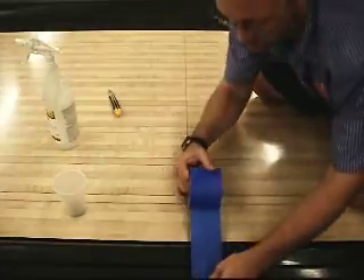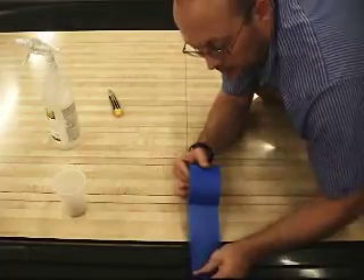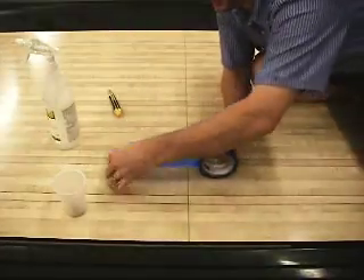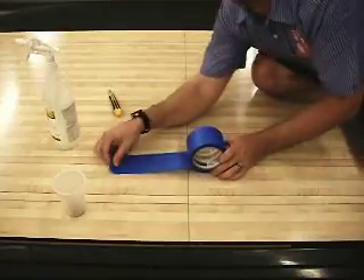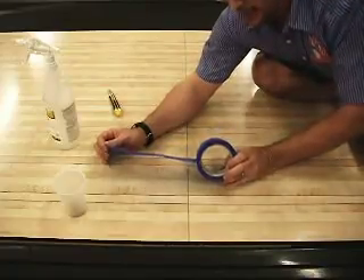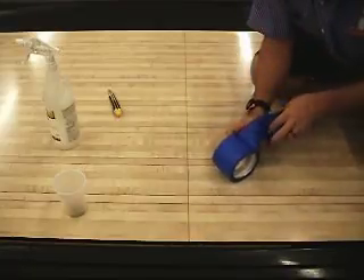Make sure your bull noses — the edge of the panel all the way down — are cleaned out, and tape even down the edge because you're going to refill that as well. I usually start the tape and then take it close to the panel and roll it down as close as I can to help square it up with the line. If you try to tape it down way up in the air it can get off on you. The tape itself has a little flexibility, so if you take your time you can smooth it out nice. I want a nice fresh piece of tape with a big tab.